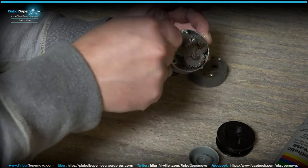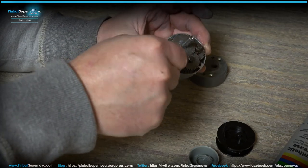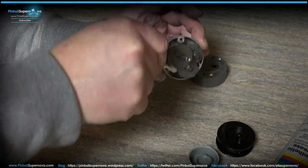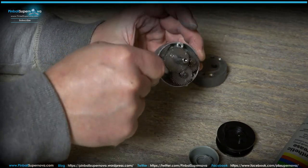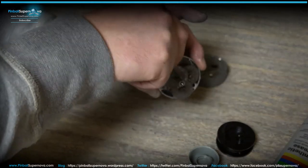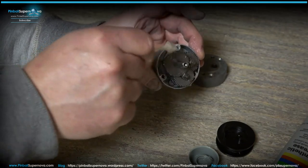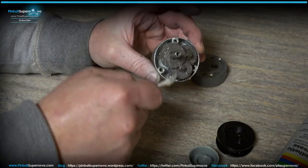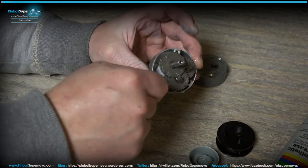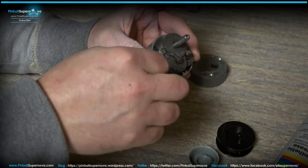It's a bit messy to do this, but you have to do this with all your motors. I've done this on my Dirty Harry gun. I've done it on Monster Bash, the Drac motor. I've done it on Addams Family with Thing. The grease, after about 20 or 25 years, gets hardened after a while. And in this video, I just wanted to show you the placement of all the gears too, because I always look for references of how the gears are laid out, and this could be a good video for that. So that should be good.